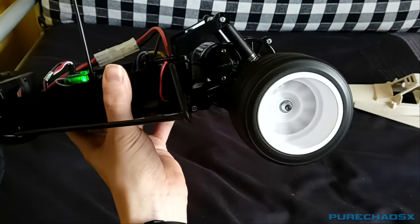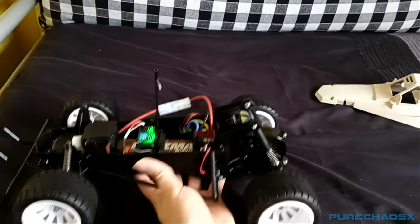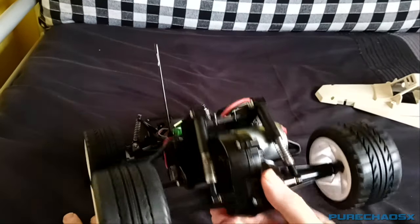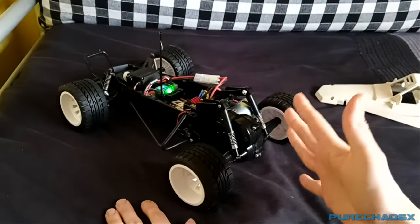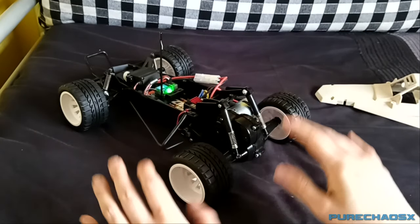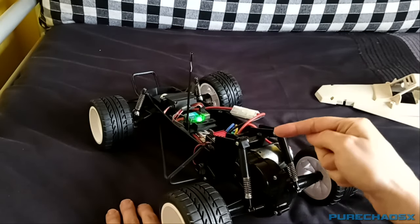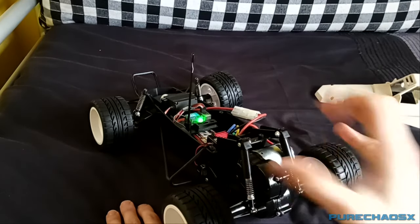This is probably a lot faster than I was expecting from a 21-turn motor, and it's using an 18-tooth pinion, so it's using the right setup. I've looked at all the gears — they're all clean, they've been greased, nothing has been fractured, cracked, or split, there's no teeth missing, the gears are in perfect condition. So it's definitely the motor against the spur, or the pinion against the spur, that's what's causing the noise.